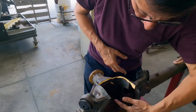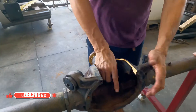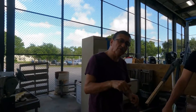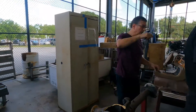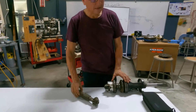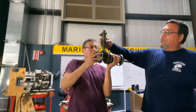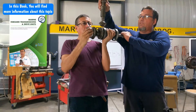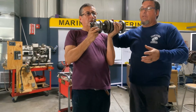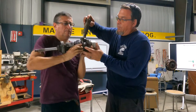Here we have one gear here, another gear here, in permanent contact. This is pretty similar to the lower unit — the gears of the lower unit. So this is basically a lower unit pinion gear. When your engine is running, this is always rotating, and the shaft doesn't rotate until the clutch dog engages whichever gear it wants — forward or reverse. Remember when I told you the engine has a shift interrupt switch? That's to slow the speed of the pinion down.